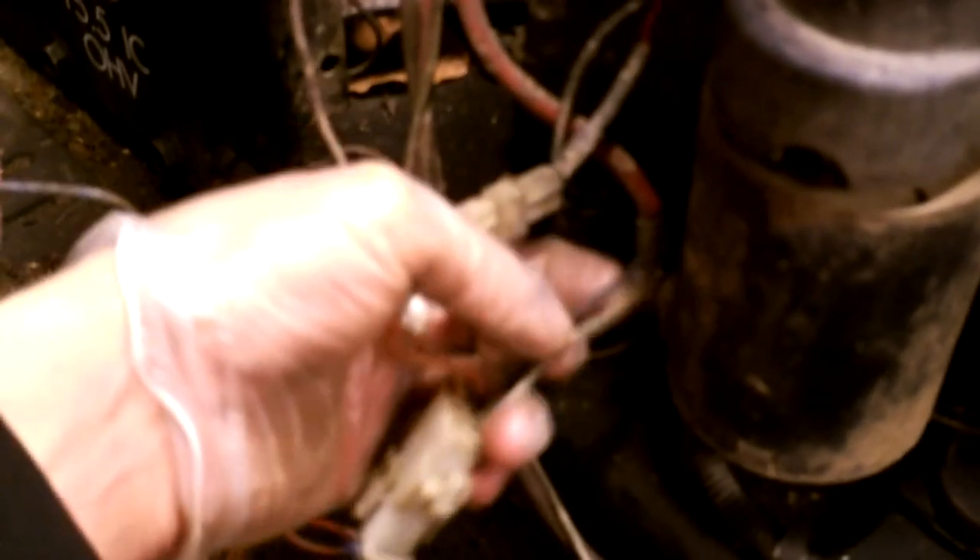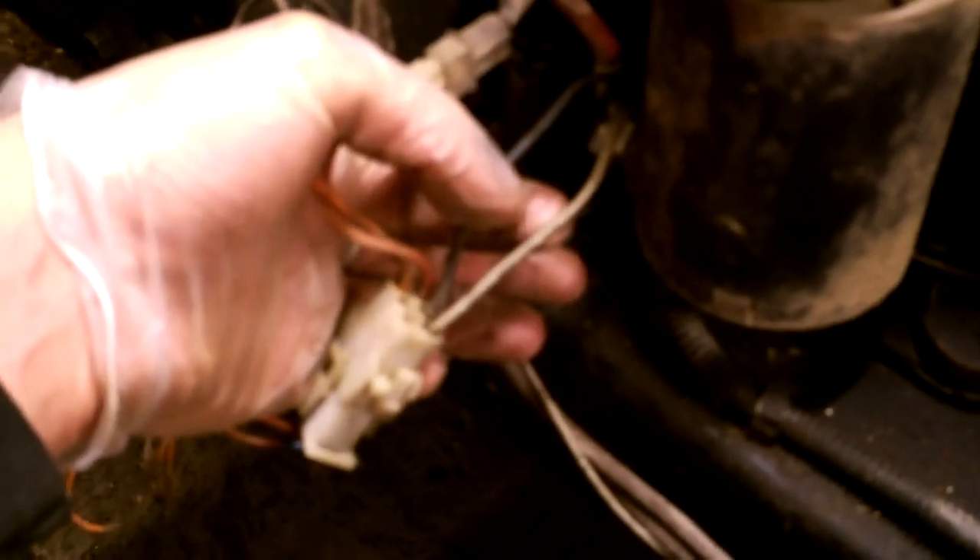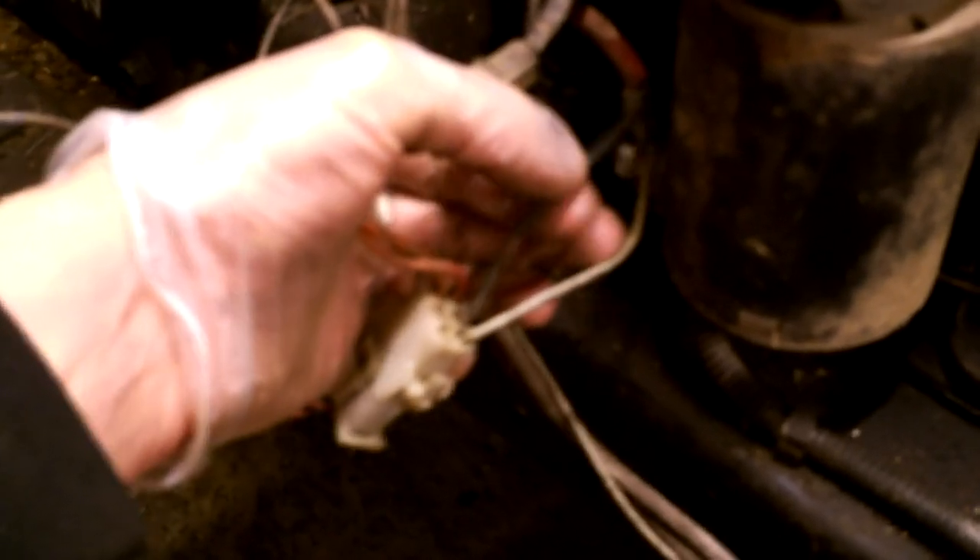On this Briggs setup you're going to have these two wires. If you have an electronic control solenoid in your carb, this is what goes to it. If you've done a solenoid delete, this is dead and doesn't matter. This is your black kill wire — this is what goes to your kill toggle. If this grounds out at any point, it kills the motor; it will not have spark and it dies. When you go through this connection, your red diode wire turns blue. That blue wire comes back through and you connect it to the red side of things further up.